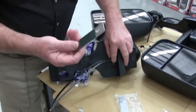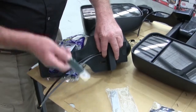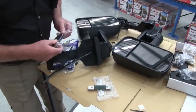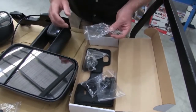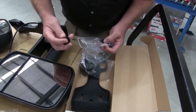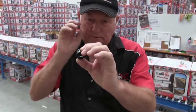We're still using the stainless steel plates with the double-sided tape for the bottom of the door. If you've got a 79 series and they had that triangular original Toyota mirror bracket on the door, you should be able to use the original nutserts that are in the bottom of the door now with these new bases. You'll get a kit with two of those rubbers that fit into the base — make sure you put them on. Inside the kit itself, you'll find eight new bolts. We use the long bolts because it makes it easier to get a start on them and they don't interfere with anything inside the car. You should get two sealing rubbers, and these are the same rotary cups we used on the other ones. If you mount that inside the door and the holes are slightly to the side, you'll be able to pick up that by rotating it and it will find its own position as you're doing it up.